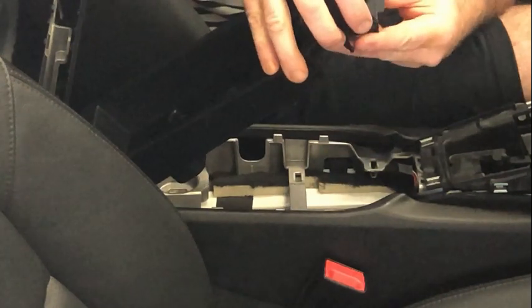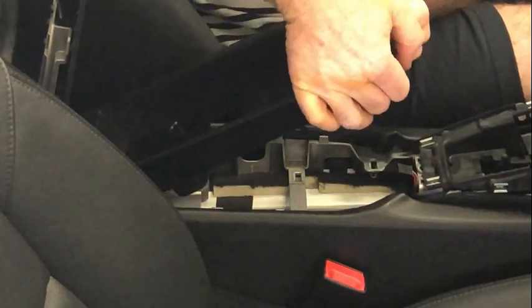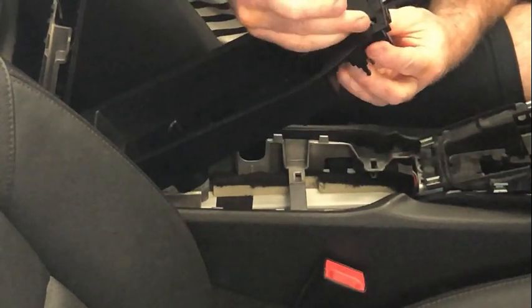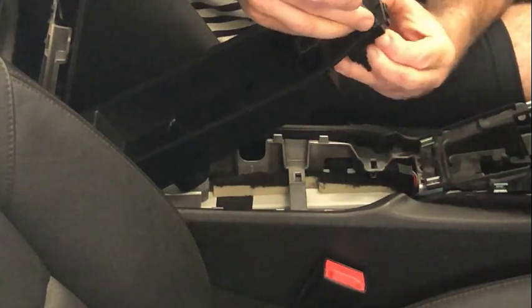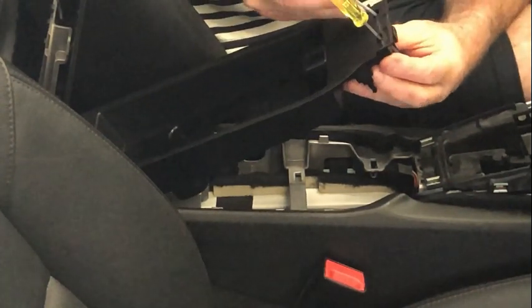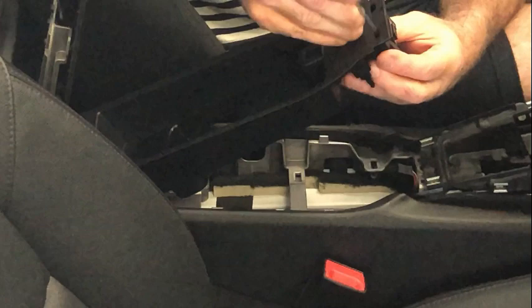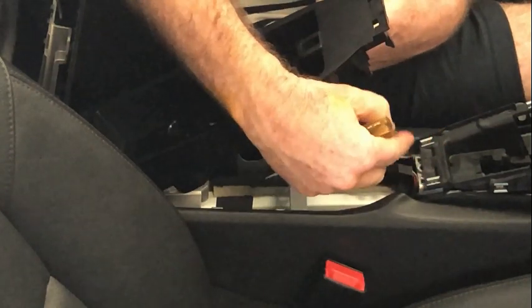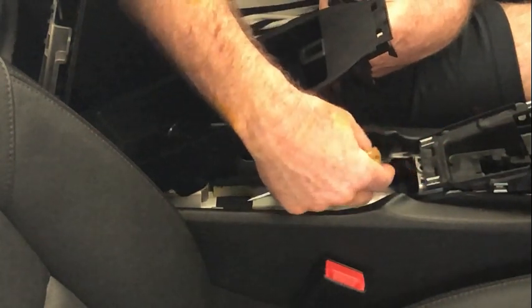And the way it's put in there is actually just slots up in there like that, and then pushes back up. So again, to actually release that, you stick the screwdriver down like that. Actually, just do it with two screwdrivers, probably easiest, like that. And then you just push it out. Otherwise the plug that goes in there actually hits that piece there, and it'll just reef the whole thing out, which is clearly not what you want to do, and you might damage the sensor.